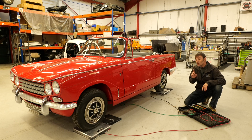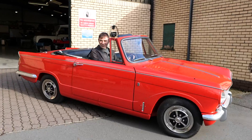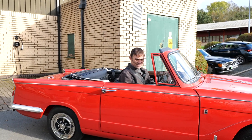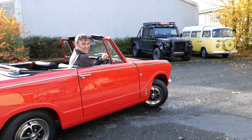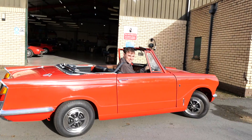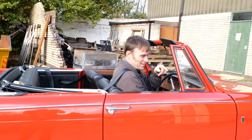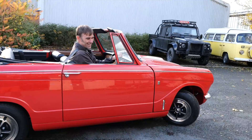I have a feeling this is going to handle better, but there's only one way to find out. I'm going to have a little cheeky drive around the car park. Apparently Triumph Heralds and Vitesses have a very famous tight turning circle — that's because of the lifting bonnet, giving far more steering lock. That's insane — it turns on a sixpence! Tell you what, this would make a good London taxi. That is impressive — that's pretty much just around where I'm standing, as you can see by the lines on the road.